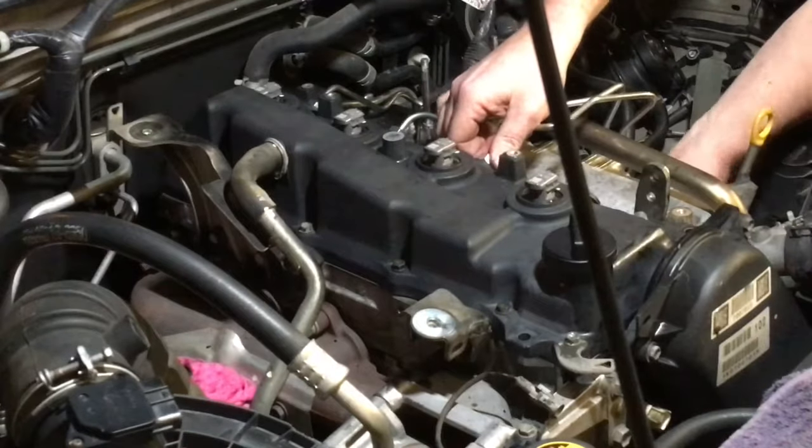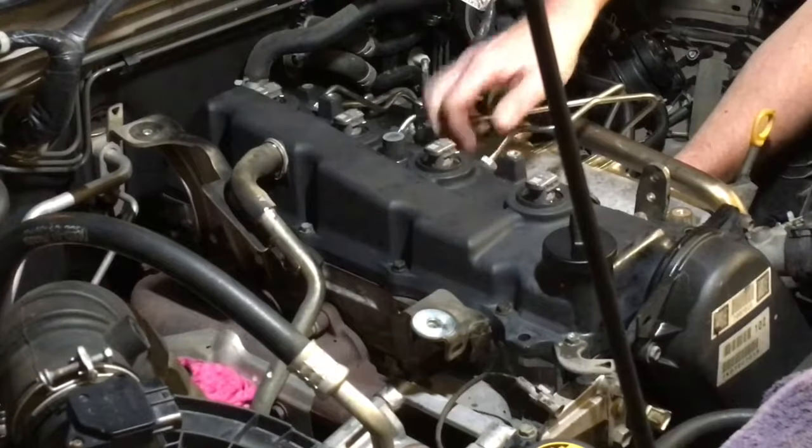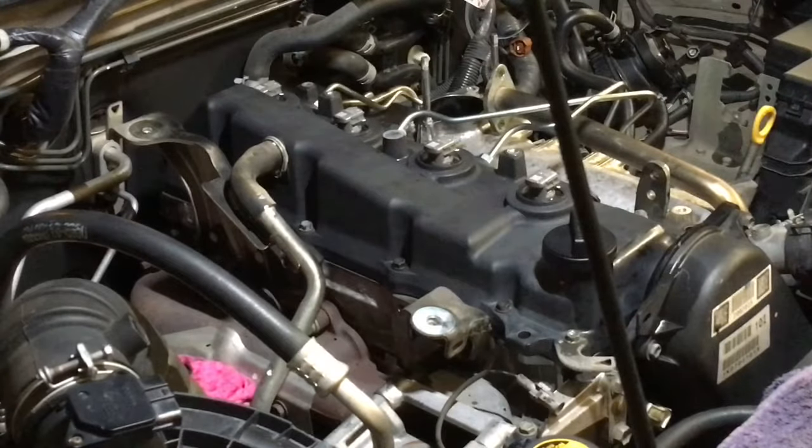Alright, so just getting all those started. Number two, the common rail on the top. Notice they're sitting nicely in the clamp like that. We can't put this clamp on yet though, because number one pipe needs to go in there, but we need to torque up number two fuel pipe down at the common rail before we go any further. So we grab our tools to do that. Like I said earlier, I think there's a chance that we could have maybe got to it, but I'm just going to do it this way. That's what we normally do, so we're going to stick with what works.